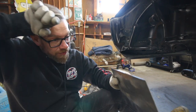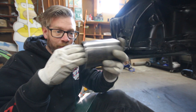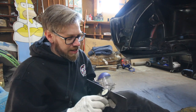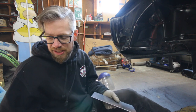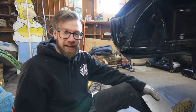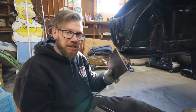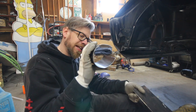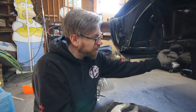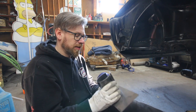I started out with a piece of flat steel and basically got it into a curved bracelet shape. The stock is 60-thousandths — I'm not sure of the exact hardness, but it's just some stock I had left over from when I did the inner rockers. I'm going to do the same thing for the other one, so I'll have two pieces that fit up inside here pretty good, and then I'll just have to weld them in and cut them to fit.